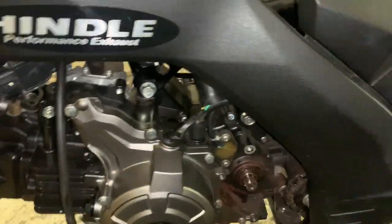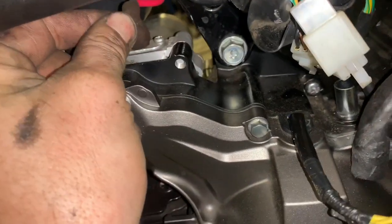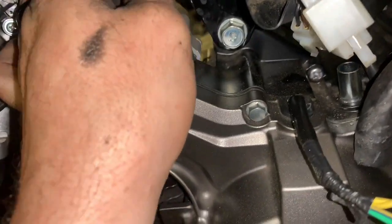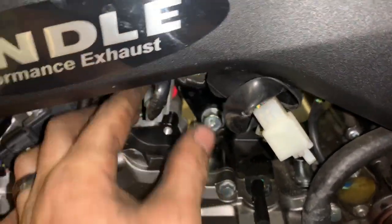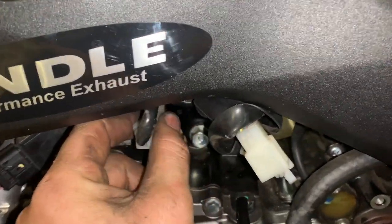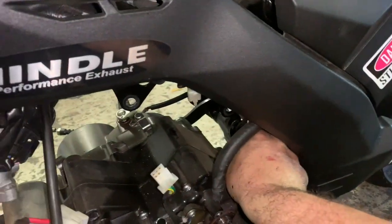I've got to spin the nuts off, pull the bolts out, and we're ready. With that one motor mount bolt unhooked, I've got to pull the starter bolt off right here. It had a quick connect, so I don't have to unbolt it — I'll just hook the quick connect. Pull the one motor mount bolt and we'll have it out. Temperature sensor — got it unhooked. Now everything's loose, so I'm letting it down on my feet. She's out! Speed sensor right here. Now we've got everything out — put it on the table.